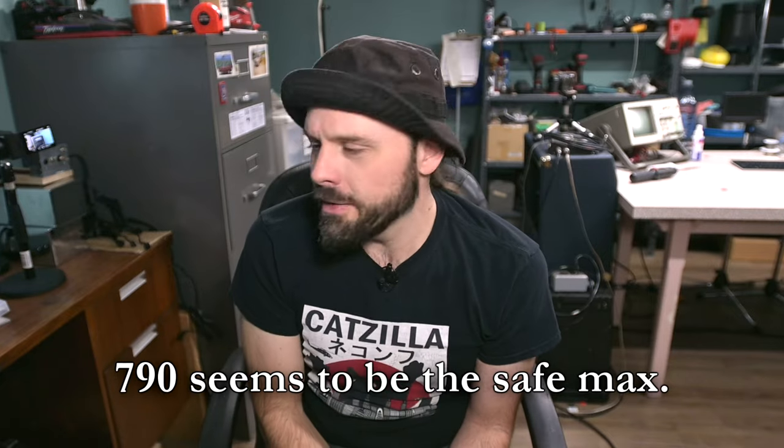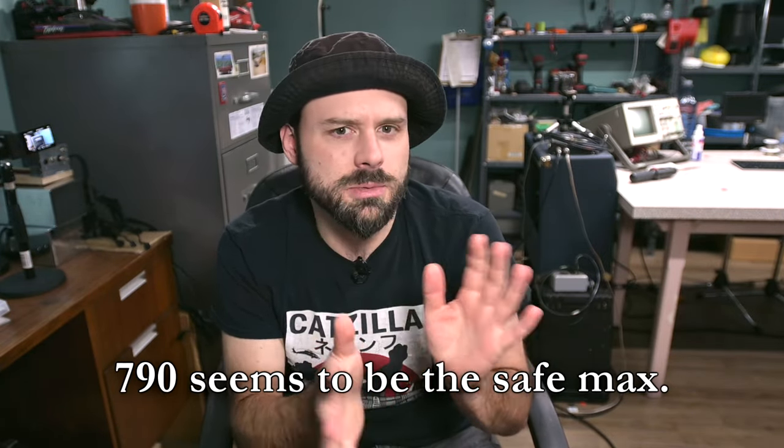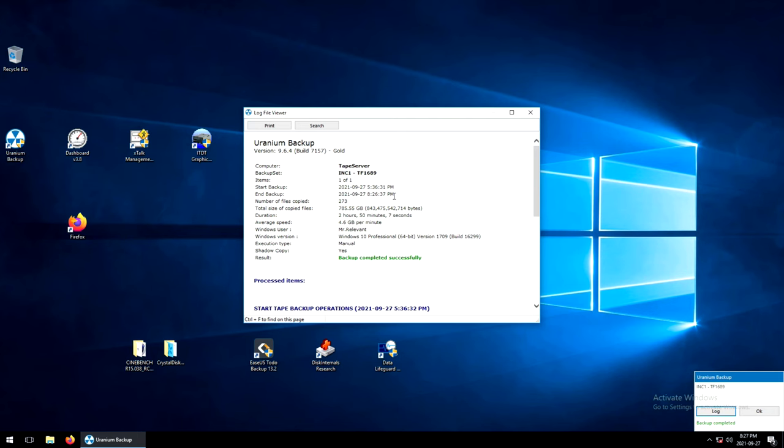So I guess we could get up to 800 gigabytes out of a tape, even though that's hard because it means I have to find an oddball project that slots in there. It's just more trouble than it's worth. So a little bit of overhead's getting written off there. 785 gigabytes written to a tape in 2 hours and 50 minutes. Not quite the 2 hours I promised you, but nonetheless, that's 2 hours faster than the old drive. And the old card might have been in the 3 hours. The old card was good when it was working.